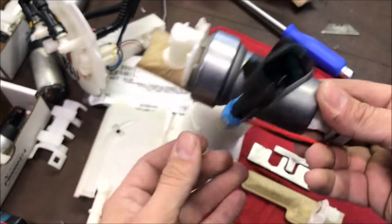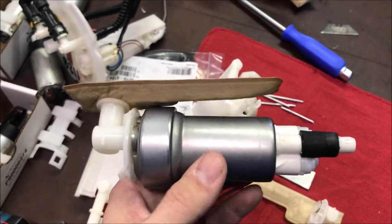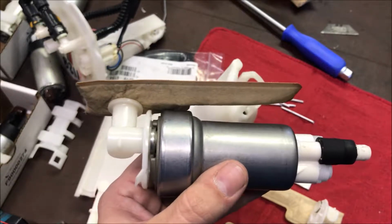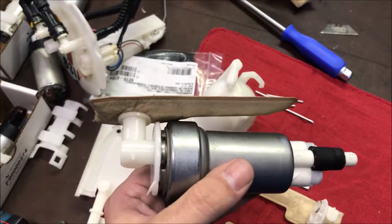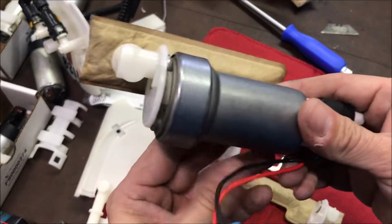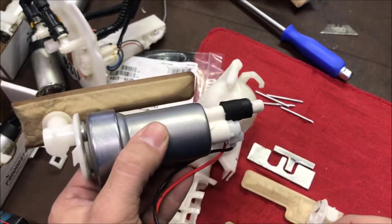and he can get you pretty much whatever you want. So I had some problems with the Visconti fuel basket. I don't know what happened. Some wires melted in the tank, and I called John and I was like, hey man, had some problems. He said send me all that stuff and he'll fix it. I was like, all right, cool. So I sent him the basket. I sent him another set of 485's and filters and stuff like that for his pump. I had bought an extra set because I thought I might need it. Anyway, sent that all to him. He's working on it. In the meantime, I still want to drive my car, so I thought to myself, maybe I can fit these Walbro 485's into a stock housing. And I was able to do that, and I want to show you how I did that.